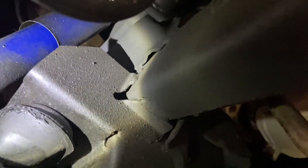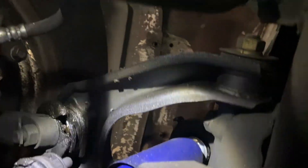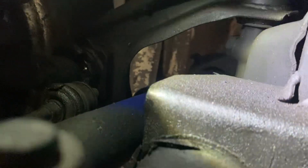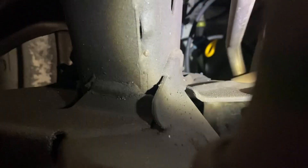A lot of these issues I feel can be linked to when we lowered the front end. We've got some leakage here by the driver's wheel. We do have some on the bottom of this hose — we installed that hose about a year and a half ago. We're also having to replenish our brake fluid quite often, so I'll revisit the brake fluid and try to find out what that leaky piece is.